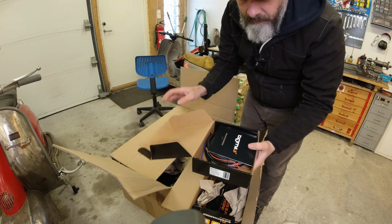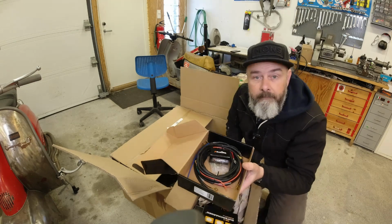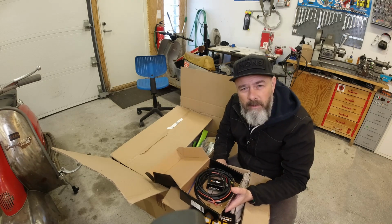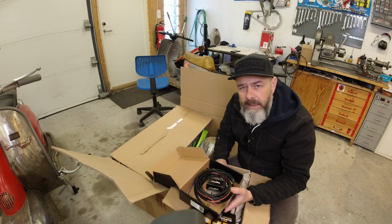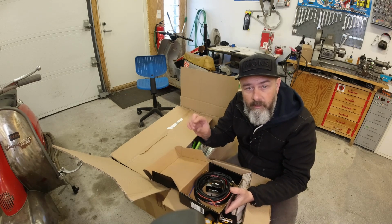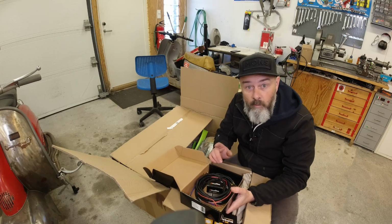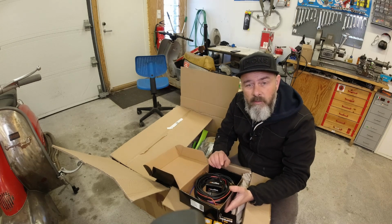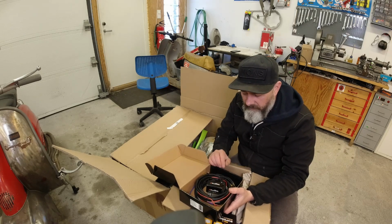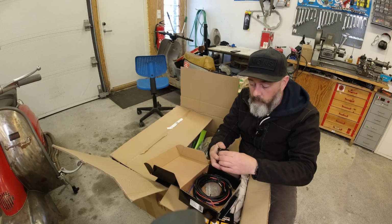A 12 volt wiring loom, so that you can convert your small frame into 12 volt. And the handy thing is, we've got so many PK engines up there. What we're actually thinking of doing is changing out the PKXL crankshaft, because the taper, just like on Lambretta, the tapers are different on the small frame and large frame, or the newer ones. And we're going to be fitting the 12 volt ignition that we know works off the PKXL that we started up at the end of the first video on Vespamania. And handily, because we were missing that, it also comes with a switch.